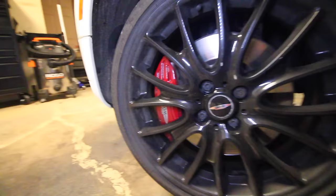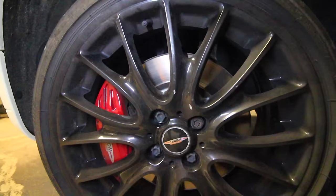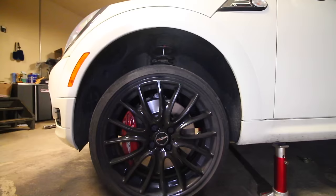To get the best clean possible, you have to jack the car up and remove each wheel using an impact gun so you can get the brake dust found on the barrel of the wheel, on the back side of the spokes, and you can clean up your brake calipers too. Like in the first video for the golf build, I cleaned the wheel wells first using Meguiar's super degreaser. First things first, let's take each lug nut off and see how bad it is — and in the midst of taking the wheels off, look who came back for a visit: Le Frog.